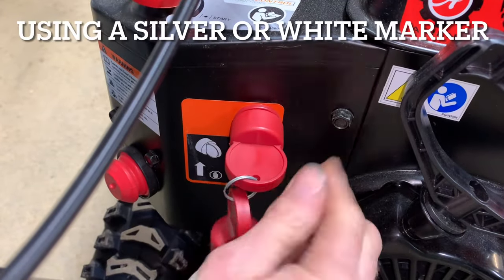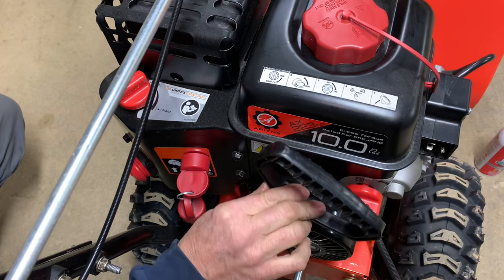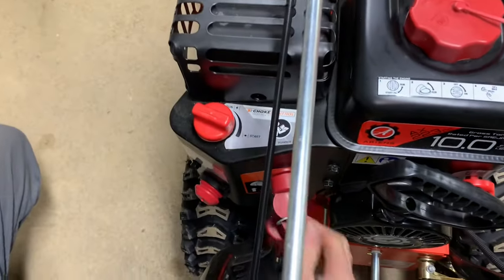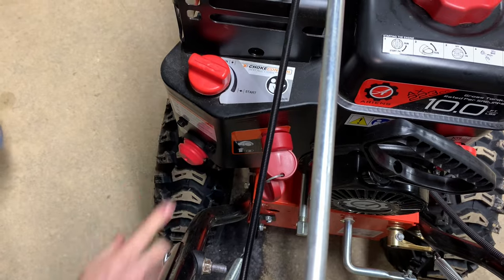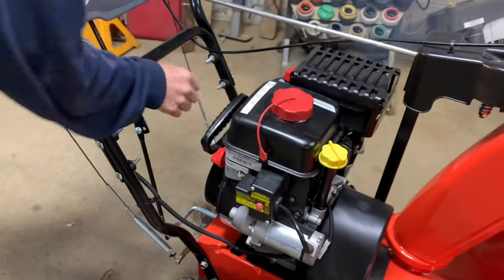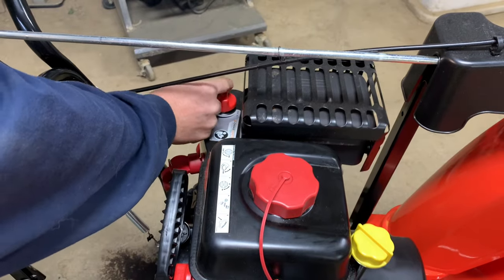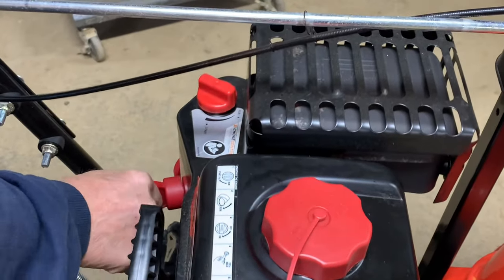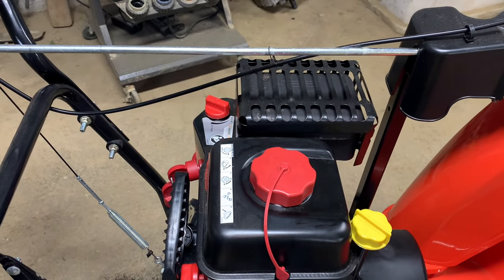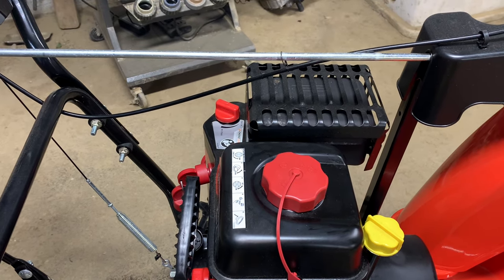To start it, make sure the fuel is on, the choke is in start, and the key is on. I'm going to prime it three times — one, two, three — then give it a pull. I'm going to turn it off right after it starts because it only goes up to full speed and you won't be able to hear me. After starting, I was adjusting the choke a little bit. I'm at about 40 degrees in the shop, so we didn't need a whole lot of choke. But when you're out there starting this for the first time in very cold conditions, you'll probably need to compensate with the choke — and remember, once it warms up, take that choke off.